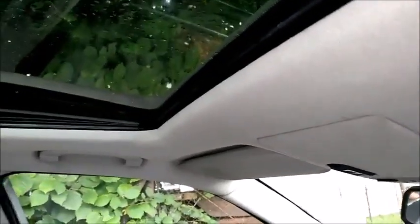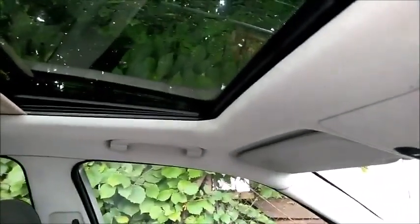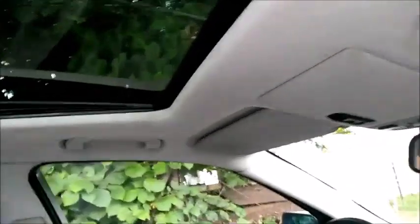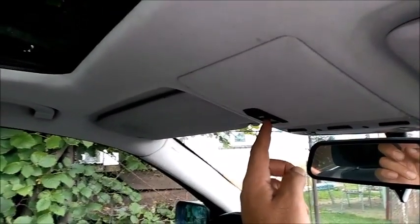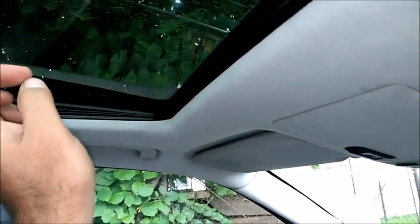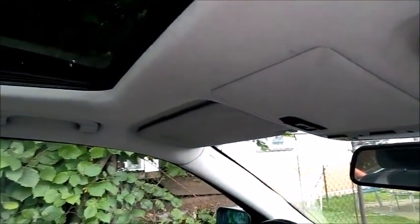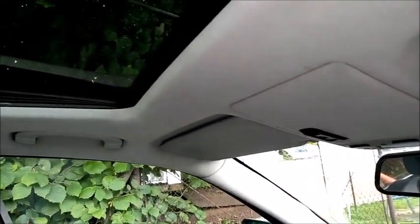Second is the natural curve. Natural curves is the opening and closing of the sunroof. In the up to March 98 models, it comes automatic from the computer. It is programmed, and you just hit the tilt button for 20 seconds until it will tilt first, and then at the end it will move a little bit around, like half centimeter, and go back. And this is done in 2 parts: normalization and natural curve, or like the curves of the sunroof.